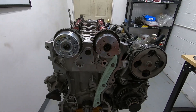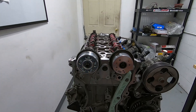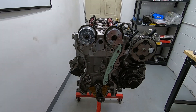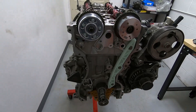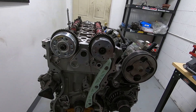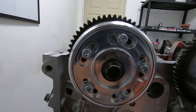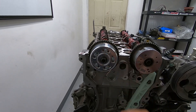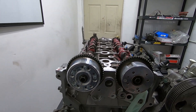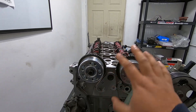There's another kind of timing, which is cam timing. In Mitsubishi it's called MiVec, and it's also in reference to the crank positioning — which is in turn the piston's positioning. This is an Evo X block, and it has both intake and exhaust MiVec. On this particular one, we've deleted the exhaust MiVec with a Magnus billet cam gear, because the exhaust with the tougher spring tends to bend these gears, distorting and warping them, which messes up your timing.